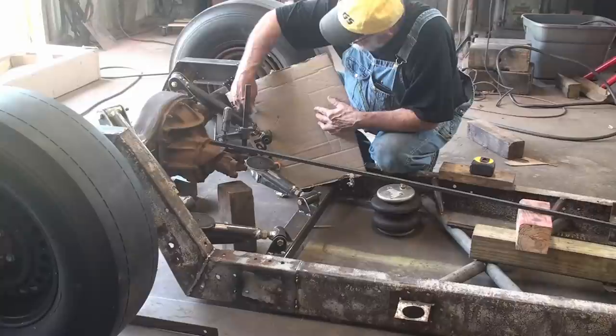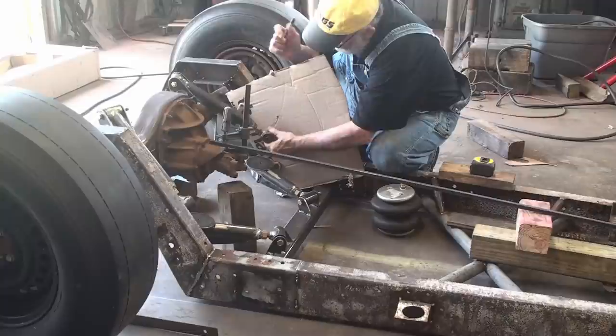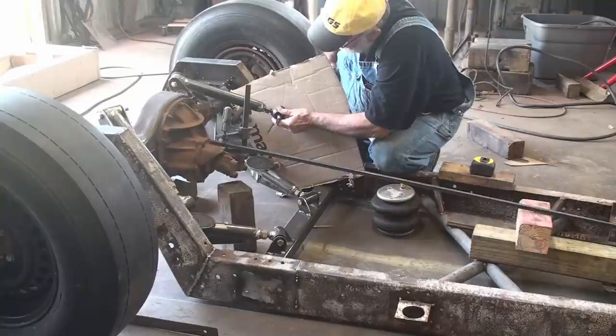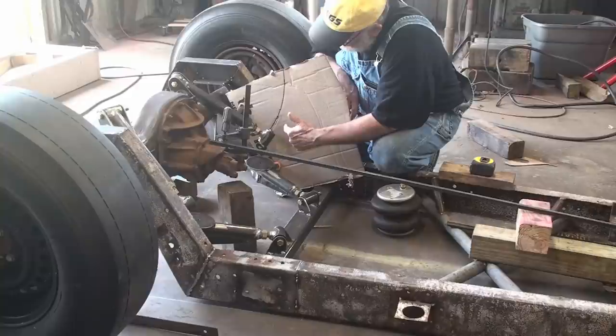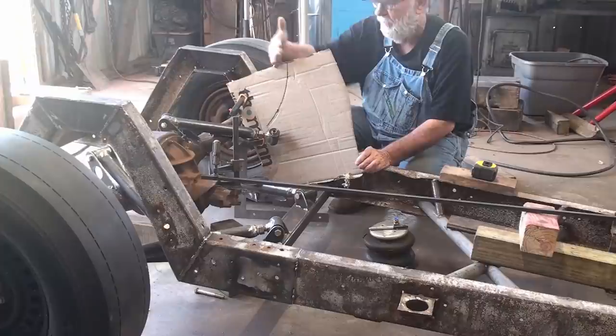So you've got to have that right. What I've got is a piece of cardboard clamped onto the frame so it will stay in place, and a felt marker. I've got the frame slammed all the way to the ground. I'm going to take this felt marker, stick it through where the bolt goes, start at the bottom and run it up. So I've got a mark right there with the frame all the way down. Now I'm going to jack the frame all the way up and do the same thing. Needless to say, when you're all the way down, you need to make sure your rear end is lined up with your mark — straight, centered.